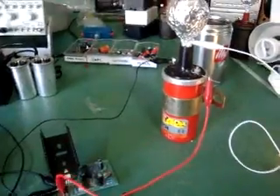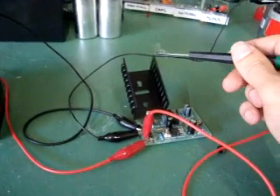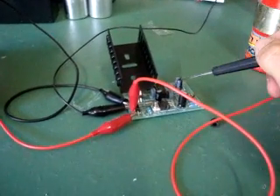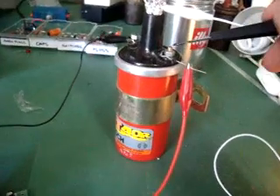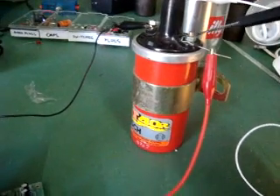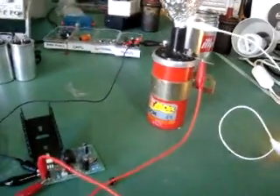I'm going to show you how this energy is bouncing back through the low voltage side — the 12-volt side. It only seems to happen when I have all these hooked up. So the other side is just grounded and I get sparks coming off everything pretty much — even the heatsink, these bits, the positive terminal, negative terminal, and the ignition coil. High voltage is coming back through this diode.